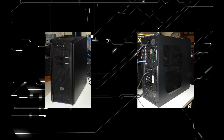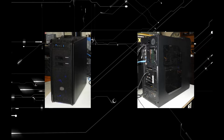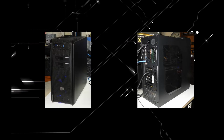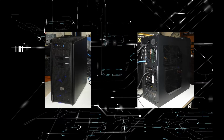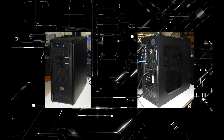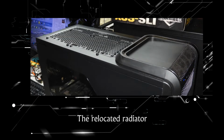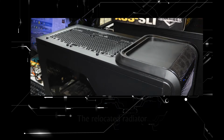The can is a low-cost black ugly thing. It does not have to be seen, apart from whether it's turned on or not. The front has 2 removable disc caddies that are purely passive SATA connections, with no electronics in between, and 2 push fans to promote airflow through the can. The back end has as many open spaces as possible to aid cooling. The 2-fan radiator had to be moved across to clear the heat sink at the top of the board.